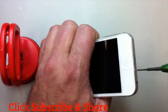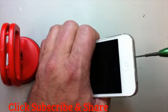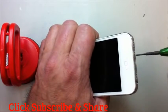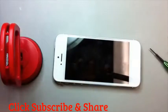We have our two pentalobe screws on the bottom of the phone, and the reason I put that orange thing over on the side is because when we open up the phone, we don't want to have any of the weight from the LCD resting on the flex cables, so we're going to prop this up here, you'll see shortly.